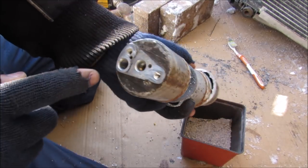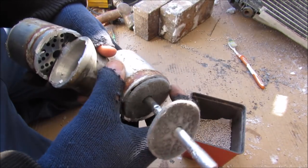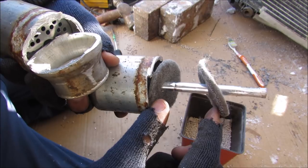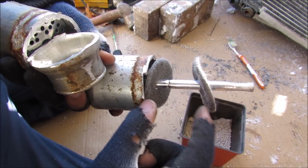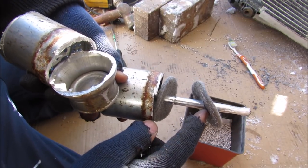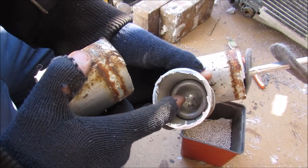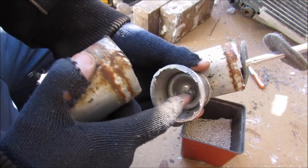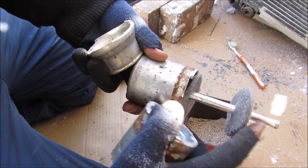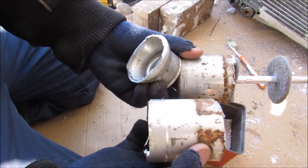So just to explain how the dryer works: refrigerant enters the outside port and first goes through the first grate on the inside. Then it will go through this filter like material. This empty space, which was filled by desiccant, is going to absorb some of the moisture. This felt filter also traps some dirt. Then it goes through the second felt filter and then finally the last grate. Before entering the bottom of the canister which has this empty space, extra refrigerant is going to stay at the bottom of this canister until it needs to be used. Then this long straw is going to suck up that refrigerant from the bottom of the canister and go back into the AC system to be recycled again.